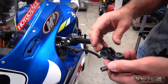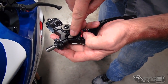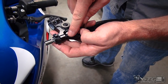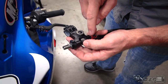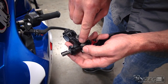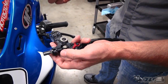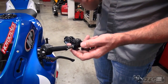That crash-rotation feature is pretty bitching and can help out in a crash. The part that attaches to the clutch cable has three positions. If you install it furthest from the rider per CRG, it'll give you a firmer clutch feel. The center position reduces that a little bit, and all the way towards the rider makes the clutch pull just a little bit easier. You can kind of tune your clutch feel — whether you're racing or street riding — to dial in exactly what you want.